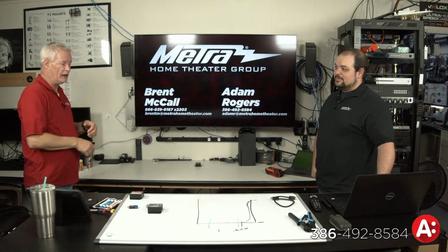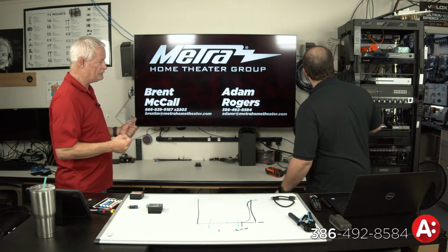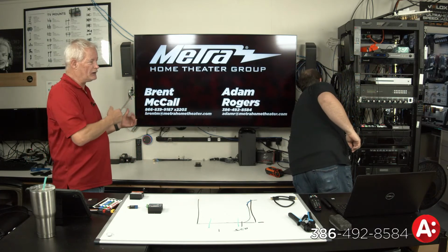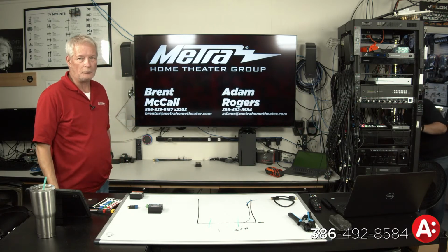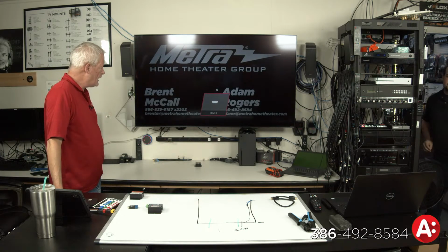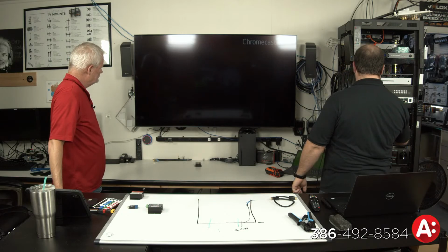Right, so if you have a device that's not enhanced, say a cable box that does not support HDR or deep color, and you have an AVR that's only global in its assignments, that can be a problem because that metadata is being pumped out every HDMI port. And if the source does not recognize the metadata, it will not work properly or at all. So there are times when you have to turn off enhanced even though you want it to make it work.